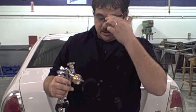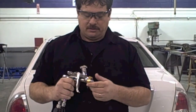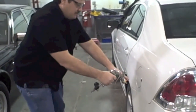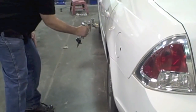Now let's talk about gun technique. If I could give you one piece of advice, it's to be really consistent. Being a good painter is about consistency. At the factories, robots do the exact same thing every time — if you can do that, you'll have it down. Speed and distance are what you have to manage together, and that makes all the difference. Think like a robot — keep the gun straight. You don't want to tilt it because it will be heavy at the top and light at the bottom. You have to stay straight and move at the same speed every time.